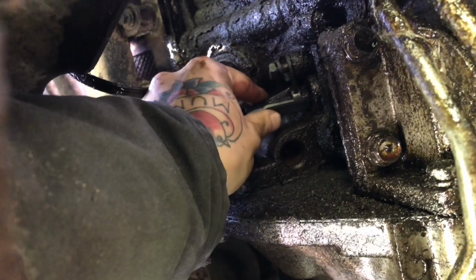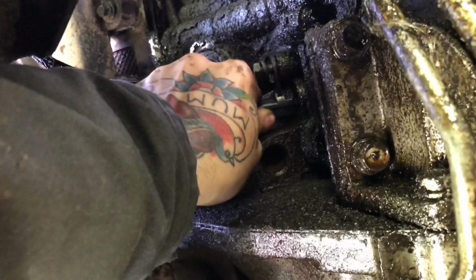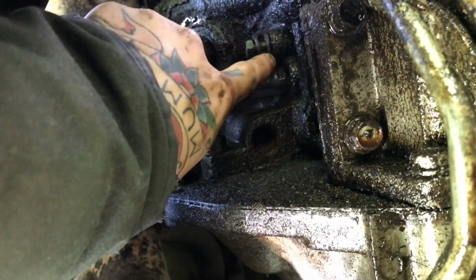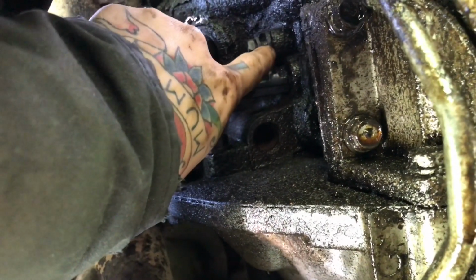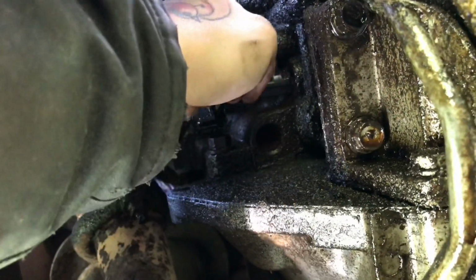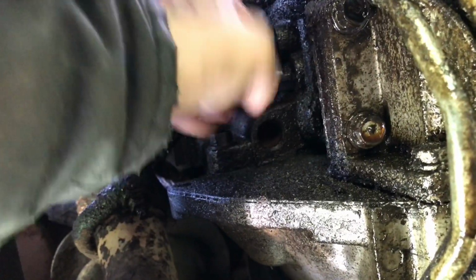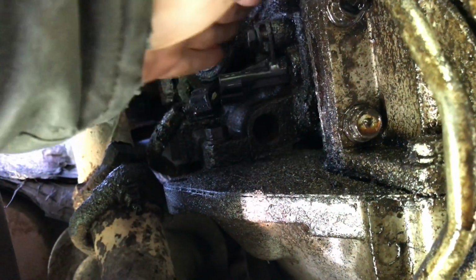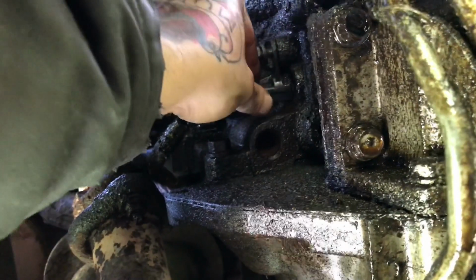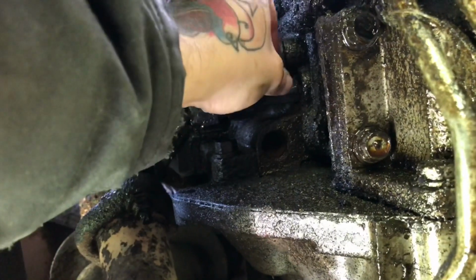And then you're gonna grab the sensor here, and then you're gonna wiggle it and move it back to a point where you have just enough room where the bracket holds on to the body. You're gonna grab your pry tool, you're gonna get in there, you're not gonna pry, what you're gonna do is twist. And in twisting it in that fashion, clockwise, depending on which way you're looking underneath the truck, that's gonna pull the sensor out, and you're gonna continue doing that till it comes out.